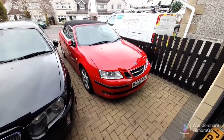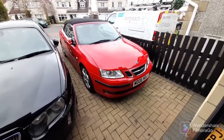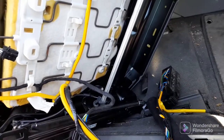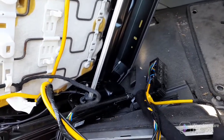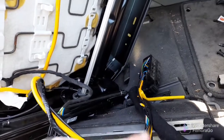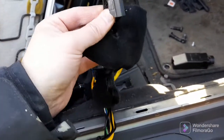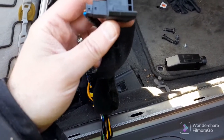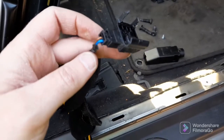I tried to repair the plug, didn't work. Got a plug from a saloon, didn't work. Tried to crimp it in, didn't work. So I really needed a complete seat loom and went up to u-pull-it this morning. The proximity sensor shows how close the seat is to the airbag - if it's too close, the airbag will be deactivated.